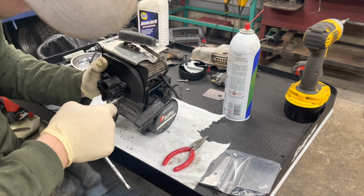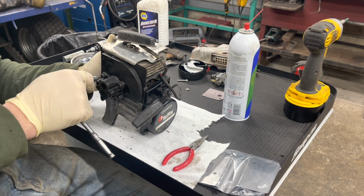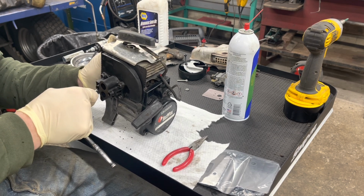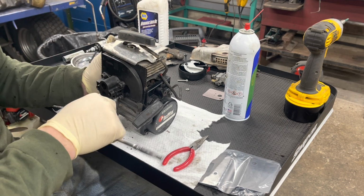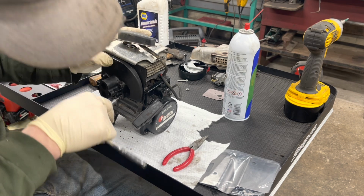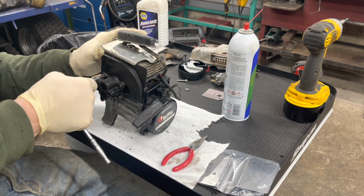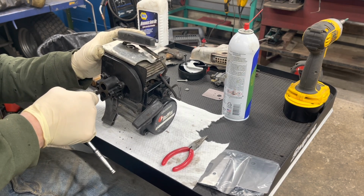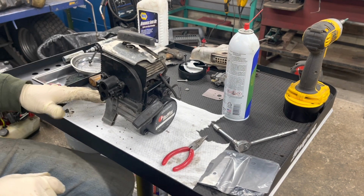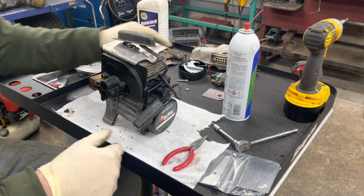This particular pedestal is the spot where it all leaks from for the most part. So I'm not saying crank on it, but maybe we should be putting some Loctite in there, some 243 blue, but I try to put Loctite where I see Loctite in the factory. If these start loosening up one more time on me, if I start seeing dirt, that's one reason I'm cleaning everything, so I can see dirt if dirt arises. And if I see dirt on here again, I'm going to pull this off and Loctite these four, so we don't have that problem.